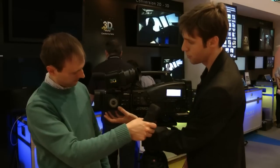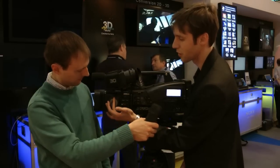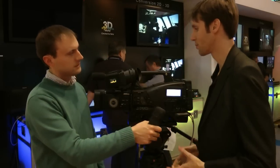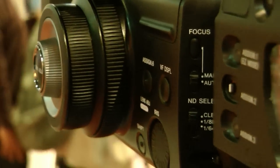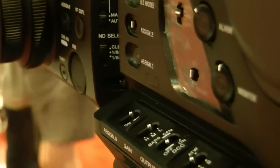We are keeping the zoom for the cameraman here. With a very original function as well: as soon as the cameraman has made the focus, instead of adjusting the convergence precisely, you can just push one button and get the convergence automatically set through the focus plane. So it's very original. We are really thinking of this product as a single-operator camcorder — avoiding the cost of a convergence puller and focus puller. A camcorder should be standalone equipment used by one or maximum two operators. This is really for documentary makers, news gatherers, or similar.